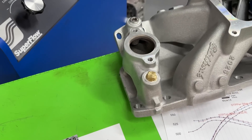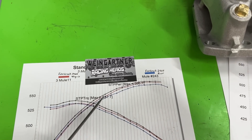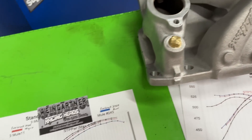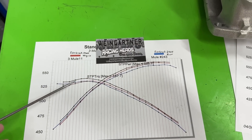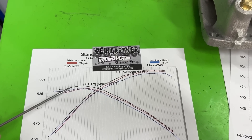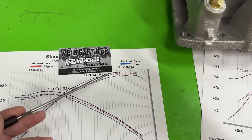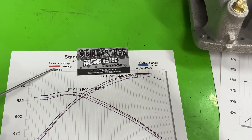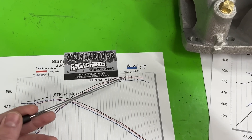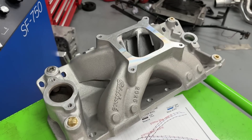Here's the perfect example — and I'm covering up the winner since that's a later video. The black line here is a manifold that's significantly smaller than this one. It was the best of all the manifolds tested. Its cross-sectional area, plenum volume — everything is smaller and it did better. So the port got a little bit bigger when I ground off the burr, but it was still less powerful than a much smaller port. So I don't know if I have a clean conclusion for that argument.